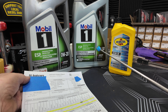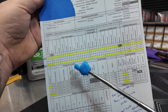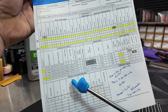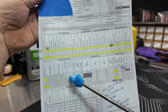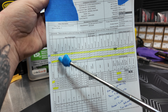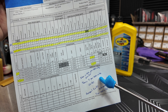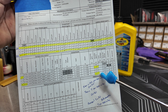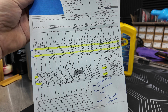What we're focusing on here is this 0W30 ESP. It has no Dexos labeling on it at all, but it is okay for emission systems. So we went ahead and did our first test. I ran longer miles on this — 6,214 miles, a lot of which was road trip, which is why my miles were higher than typical. We show 44 iron total, which at first you'd think is a little high, but that's why we do iron per 1,000 miles — and we had a reading of 7 per 1,000 miles. So this oil is actually looking really good. The viscosity is 11.2 at 100°C, which matches up with the 5W30 Pennzoil — I was very happy with that.